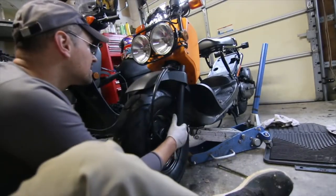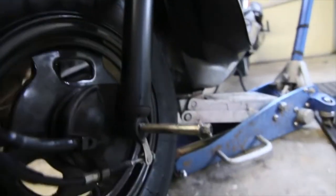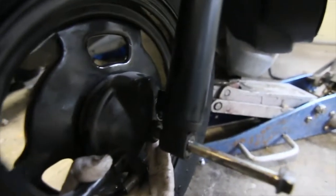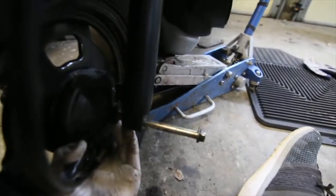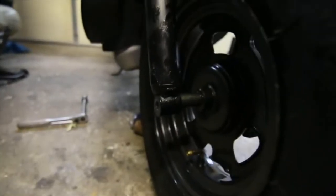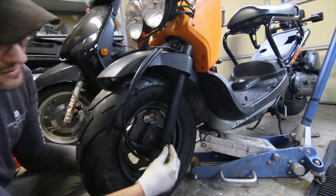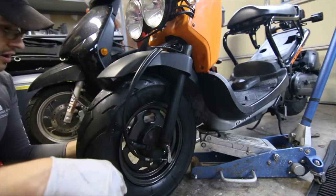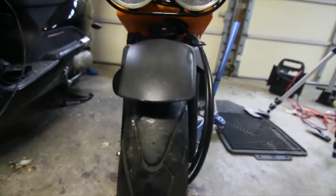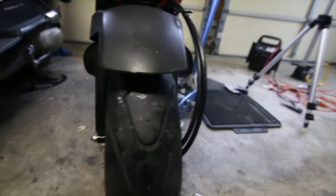Let's set the drum brake. There is a slot in the drum brake that twists — there's a slot right here and that slides into that, so it should lock in there. On this side it's gonna be a little tight to fit the spacer, but you should be able to push it in. Everything seems to be really well engineered on Hondas like this. I bought a used tire, so you have to be careful — they could be too old or very worn, but I needed to get something better on here and I got a good deal.